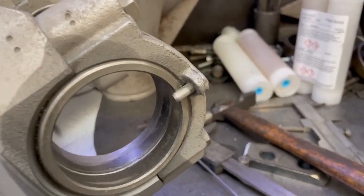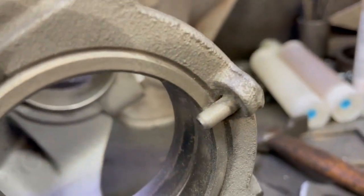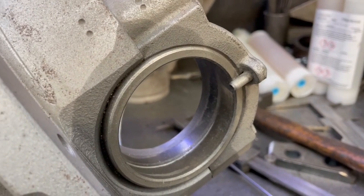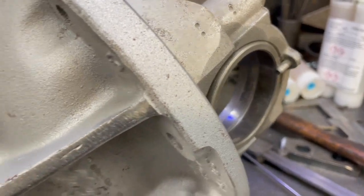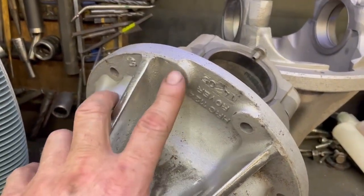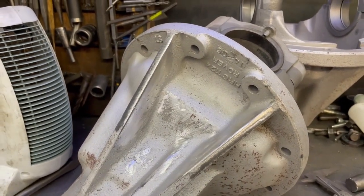To hold a diff together that is just pure cost cutting. It still has the M12 bolt and takes the standard RTC 3095. We do not like these — if it bends it lets the adjuster ring move, if the adjuster moves your diff backlash changes, and if it breaks your diff will unwind and blow up. These also have a different internal pattern.